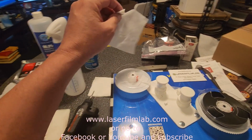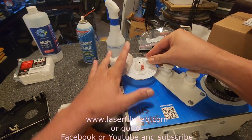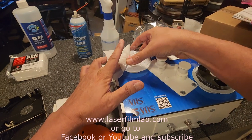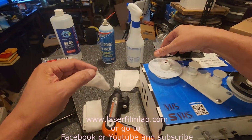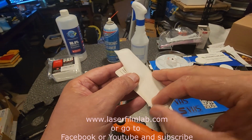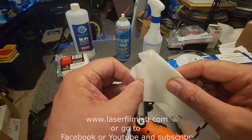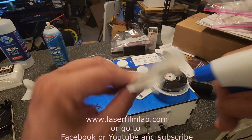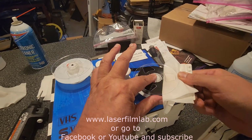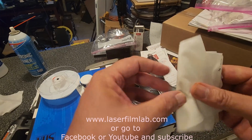We are going to get back to cleaning again. The take-up reel. Give it a good scrubbing. There we go. Yeah, that last one was kind of dirty. We're going to get another clean part of the PEC pad and clean more of the videotape. And give it a good scrubbing. Take your time. Yeah, just take your time.